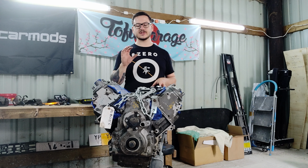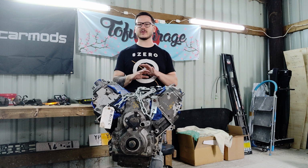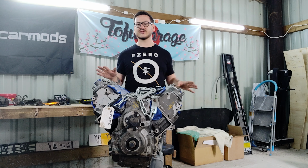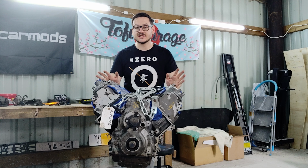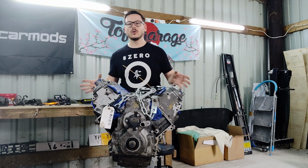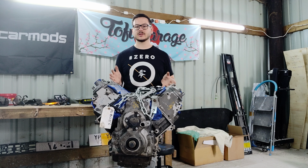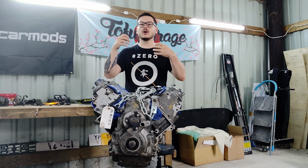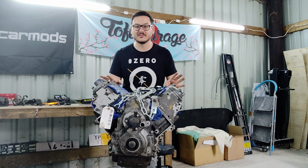It also has VVT, which, around that era, 2008-2009, is brand new for the LS engines. They were stuck to their guns, and no VVT or any of that kind of fancy valve trickery that you might get in other modern engines. And truthfully, I'm going to be ditching it on this engine. VVT is a fantastic bit of technology that really just brings out more usable torque and power across the range of any engine. Unfortunately, it's not widely supported on these yet. There aren't a lot of VVT-based cams, and it's just an extra hurdle when it comes to tuning it and getting it working. But let's face it, if you're going to go with a V8, you may as well have a great big, lumpy V8 noise.